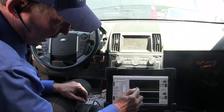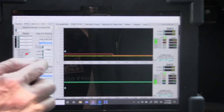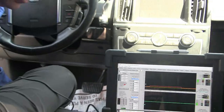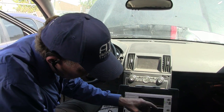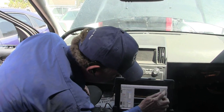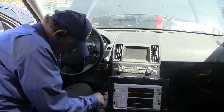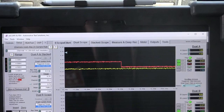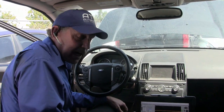I want to come over here and touch one of the CAN lines, and we can see that we've got a waveform being produced. Once I'm touching the line I can see that it has movement. Do you see that square wave in there? What that's telling me is these aren't directly grounded — that's a really good thing.